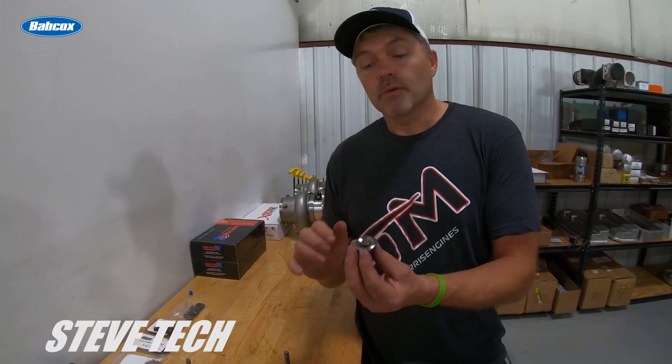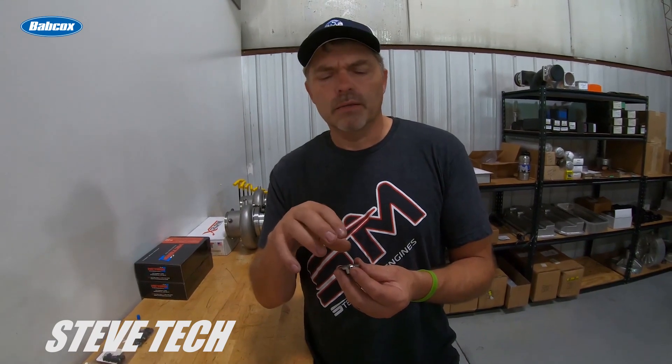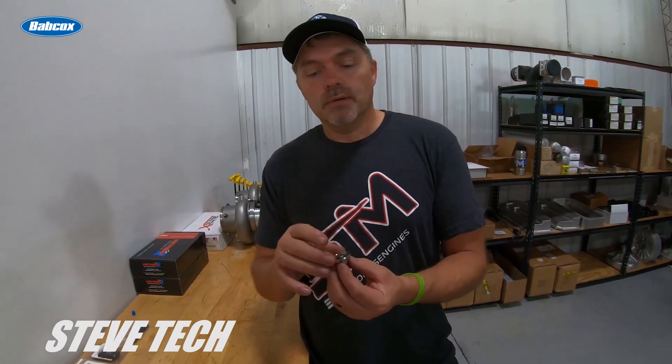My most preferable method for any application — it's a little expensive, but it's the best way — is to do the sewer lid combo. If you ever need this stuff, I'm more than happy to sell it and set you up with all the right parts matched to your springs. This is really good tech on keepers, retainers, and the lash cap design. As far as materials — titanium, tool steel, maybe some other alloys — obviously lighter is better up top as long as it's durable, so there is some compromise. Nobody really uses a steel retainer; you can get them in chrome-moly or tool steel and they're pretty good, but the titanium sewer lid combination has really been the best we've found.